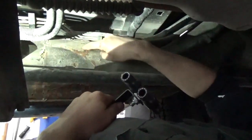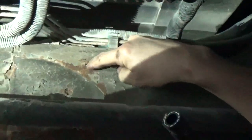All right, we're right beside the transmission on the driver's side. There's a quarter inch hole in that frame. And we're going to put that smaller line support bracket right there. And we're going to pop the bolt in, put a lock nut on the back side. And you can see there's quite a few lines there, brake lines, because the brake controller's back here. We want to keep these oil lines from making contact and vibrating on those brake lines.